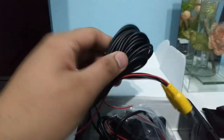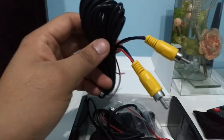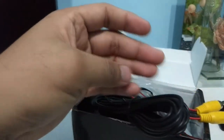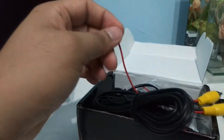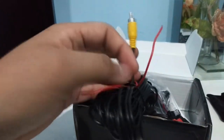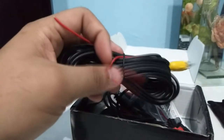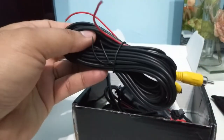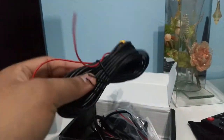Let's open the box and see what's inside. What you have is a six-meter length heavy cable. This heavy cable is very special — you can see there are red wires coming in at the end of each wire. What this does is one wire taps to your reverse lamp positive terminal and the other wire taps to your reverse trigger at your head unit screen. This will ease the process rather than using a probe to find which one is the reverse trigger. Just grab this cable through from back to front and that's it. This is the six-meter AV cable, which is very good and very important.